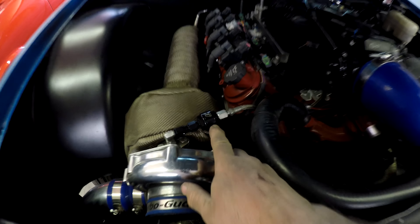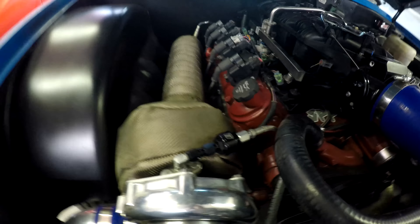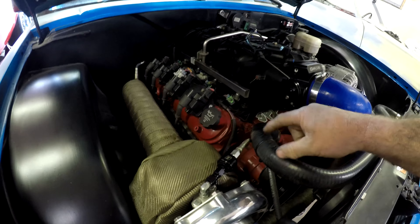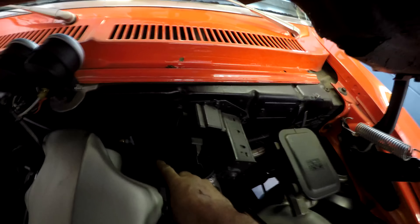I have it up on jack stands right now so I can't really build boost with it, but that's definitely how it works. I ended up putting the turbo oil feed filter on there - I used a double female dash-4 fitting to connect to the filter and then the line. I kind of wish I could keep it in one spot but the radiator hose is in the way. I still need to get another one of those fittings for the Nova - those ones will go at the back where there's a T-fitting for the two separate feed lines. The next thing to do is pull the valve body out and adjust the band. That'll be it for today guys - like, comment, subscribe, share with your friends.